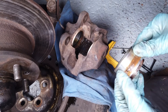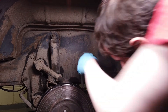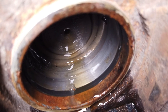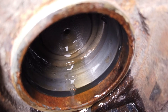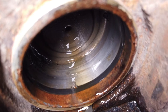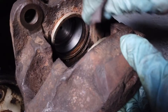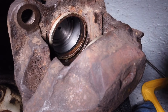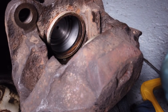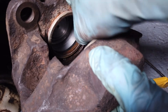There's a bit of brake fluid here - we'll clean that up. Remember to clamp up the brake line or you'll lose all your fluid. Inspecting the inside of the bore in the caliper - it looks like the seals have done their job reasonably well. The rust stops right at the edge and the inside of the caliper looks in pretty good condition actually. The outer portion has got a lot of rust on it though, so we'll continue sanding that down.